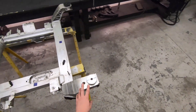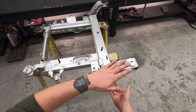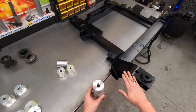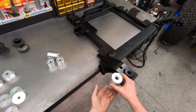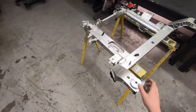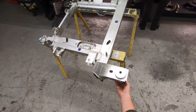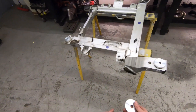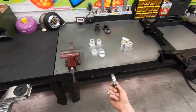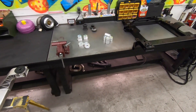Once installed, these are designed to duplicate the factory cradle spacing — how far apart the cradle sits from the body. One advantage to the weld-in style bushings is that you can adjust subframe height, and in the event that you need additional clearance, I sell spacers that sit on top of the subframe in half-inch increments. They're identical to the half-inch thick washer used on the bottom side. So if you've got a V6 with a tall intercooler or you're running a Holley Hi-Ram or Edelbrock Pro-Flo, you can purchase additional spacers to dial in the subframe height.